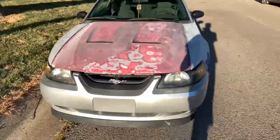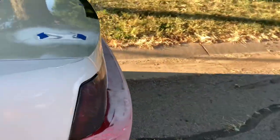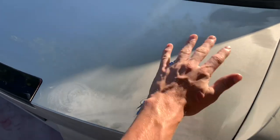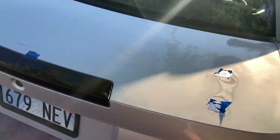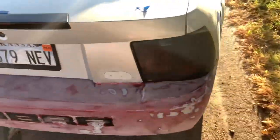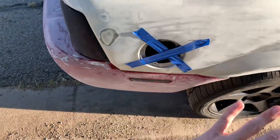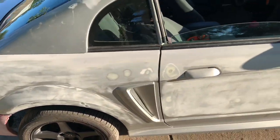What's going on guys, I'm back with another video and today we're going to be doing some body work on my Mustang. I've kind of gotten started already — we took the badges off, filled those in, did the same on the back where the Ford emblem was, sanded down the spots up here that were all cracked and a little rusted out. We took the fuel door off and we're repainting that, making it nice and smooth and flat.